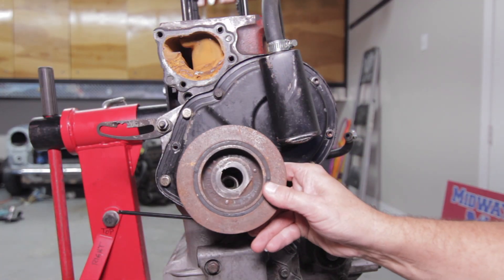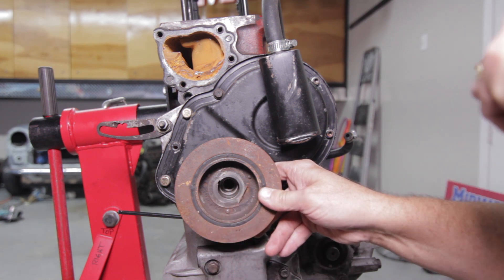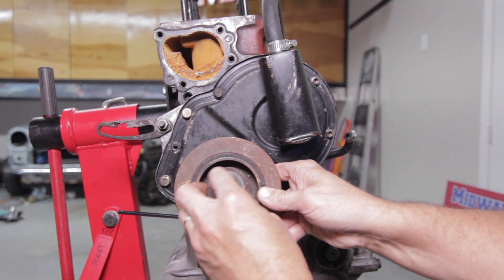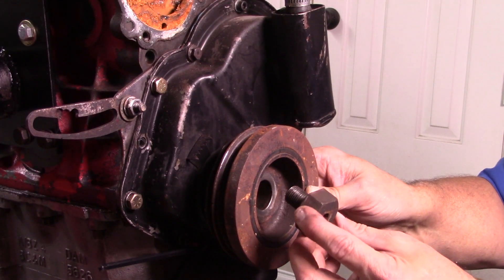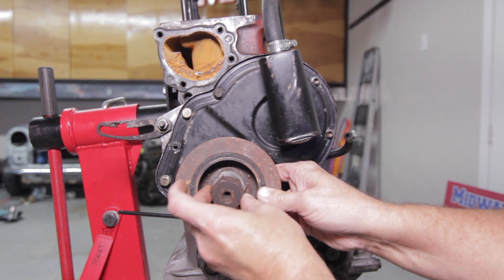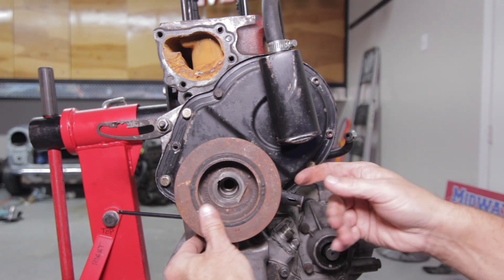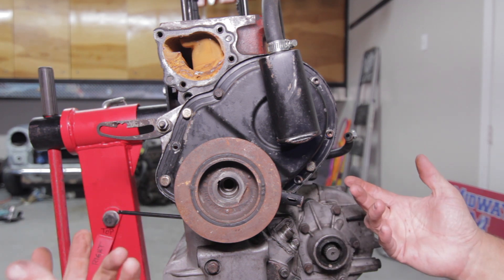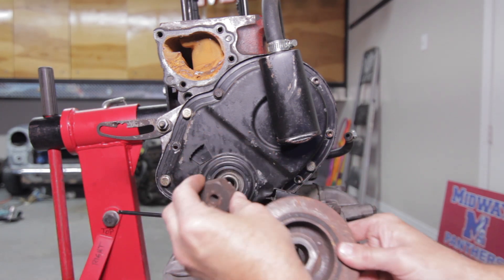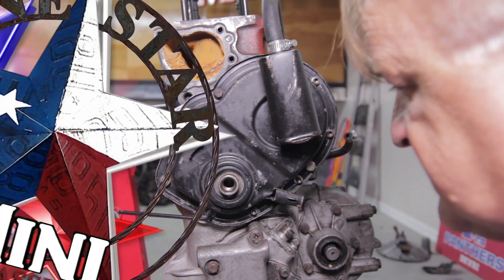For this pulley I got a little overzealous — I had to borrow a tool from a local automotive store to get this off because I didn't have a puller, and I wanted to return it the same day. With the puller on, I used the crank bolt that was there but loosened it up so it just caught the first two or three threads, then used the three-jaw puller pushed against this bolt. It pulled it out just enough allowing me to get two screwdrivers in from either side — that's per the Haynes manual — and pry it off evenly, and it came right off. The puller pulled it out just enough and then the screwdrivers pulled it the rest of the way.